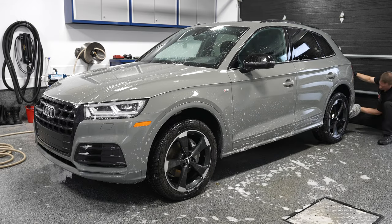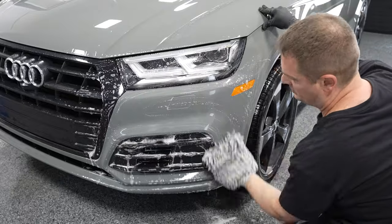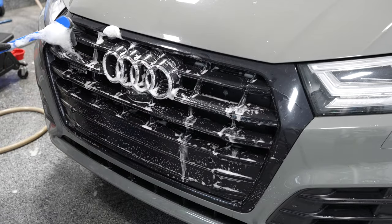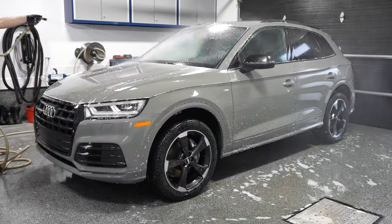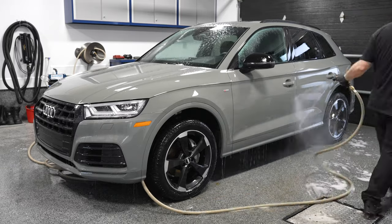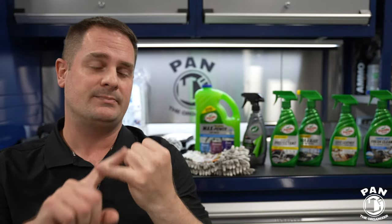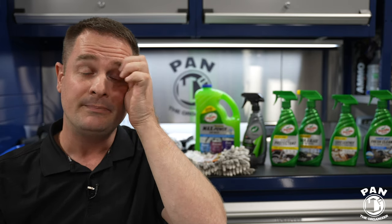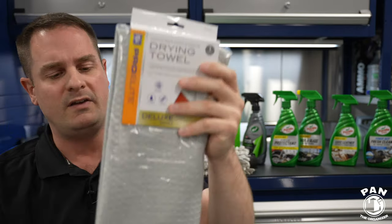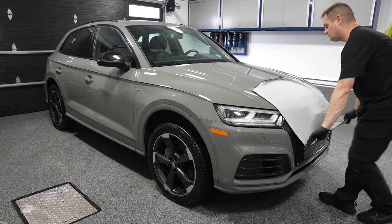When you're done washing your vehicle, rinse the entire thing thoroughly. What's cool about the Max Power Car Wash is that it rinses freely — there's no wax or soapy residue left behind. It's a great shampoo and you can use it for maintenance washes too, using the moderate dilution — just three ounces per gallon — without stripping any wax, sealant, or ceramic coating. Once you're done washing the wheels and tires, the entire paintwork, glass, and rest of the vehicle, it's time to rinse and dry the car. We'll be using a drying towel — I like waffle weave because they're super absorbent and super soft, microfiber-style, to remove all that water.